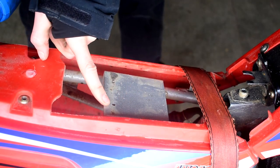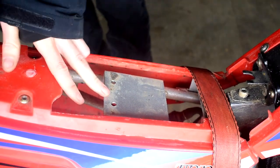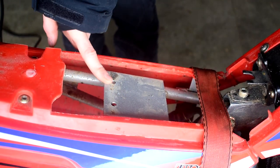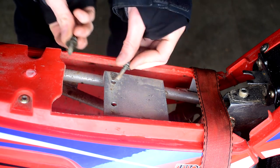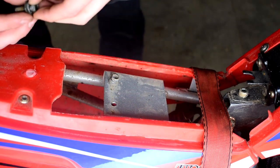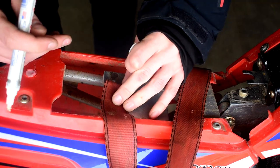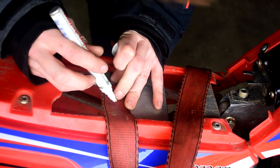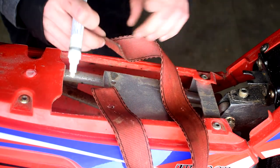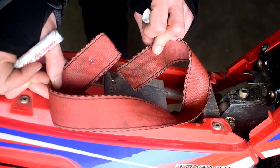Go ahead and punch these out to the next size up for the drill bits — boom, boom. These holes are only going as big as the bolts we're going to be sticking through them. Now we've got our two bolt holes for our handle. We got our two bolts here — one fits in, the other fits in, lovely. With my little paint pen, I'm going to roughly mark where the holes are on the other side so we know where to drill the strap holes.